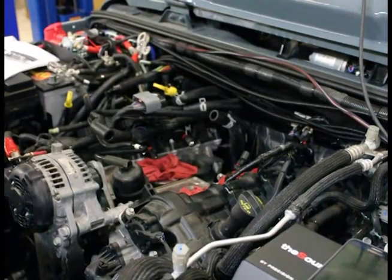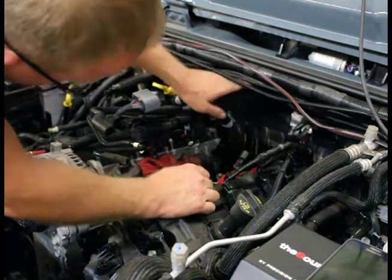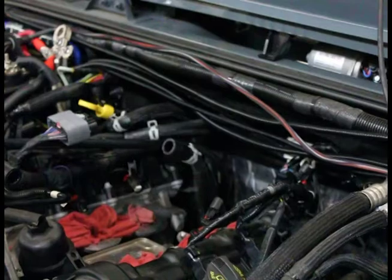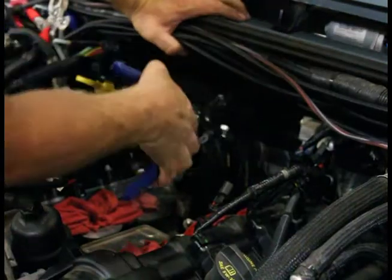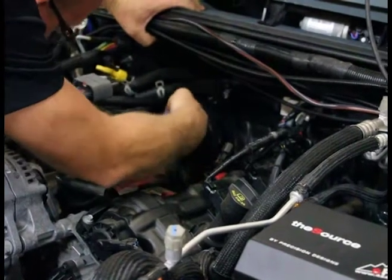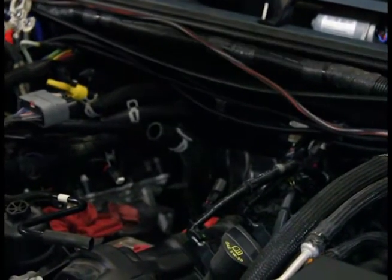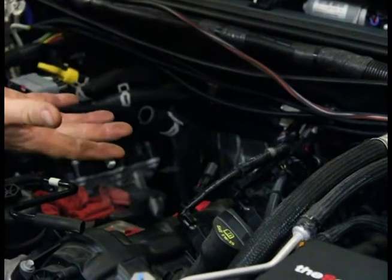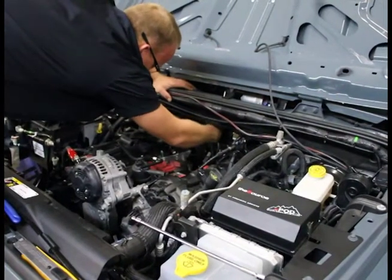Just finish putting them back in there. The next thing I'm going to show you back up over here is how to remove the short hoses way back under there. We're going to use the razor blade to actually cut the hose. This car has got some aftermarket equipment, but let's take the clamps off. You want to twist the hose but you don't want to use pliers or anything to squeeze it — it could deform the heater core, so don't do that. Use a twisting action — cut it first with the razor blade and then twist it off.